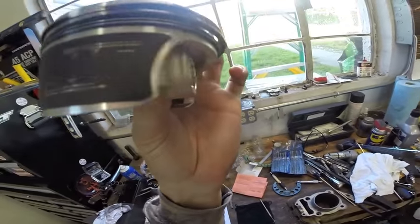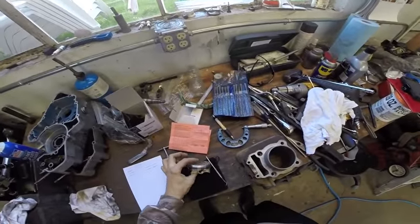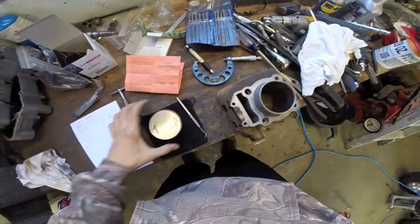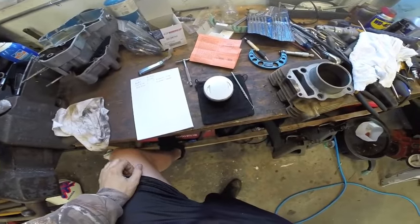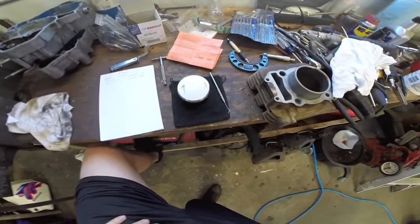You can't really see the oil expander, it's a little tiny. So that's how to install your rings. Now this is going to change for 4-stroke and 2-stroke — 2-strokes obviously only have 1 or 2 rings depending on the brand. So that's how to do your 4-stroke; we're going to go over 2-stroke here in a couple weeks.